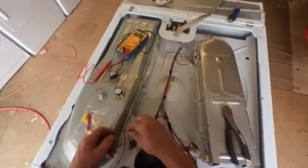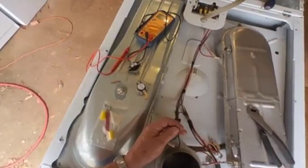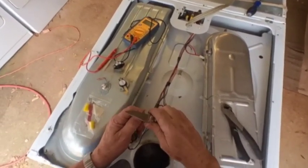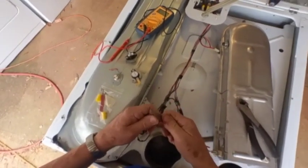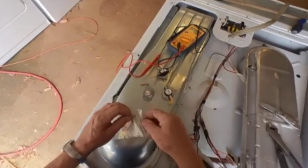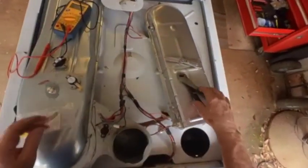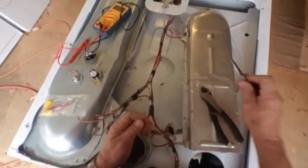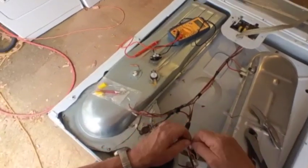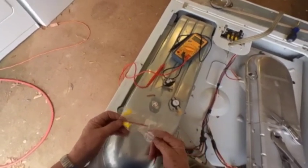You can see me here cleaning up the mess I found in there. The wires were all stripped way too long, so I clipped them off. I used my favorite stripping tool, which is my pocket knife. I don't like wire strippers — I've always used my pocket knife. And then I took one of the jumper wires that I get from McCormick. They come in packs of two and I use a lot of them. I keep a lot of them on hand, using two or three in my service truck. It's common to see an element wire burned off of some of these dryers.